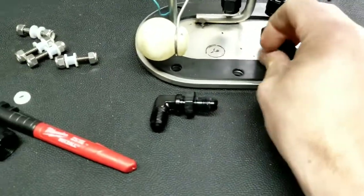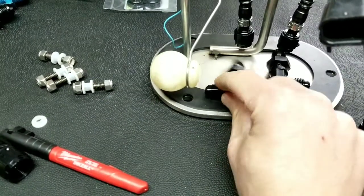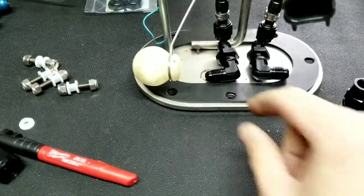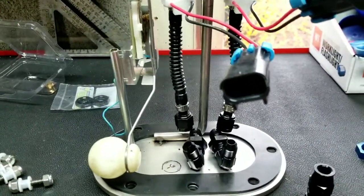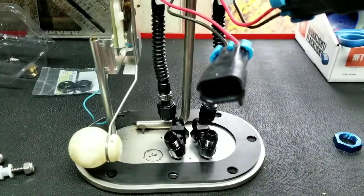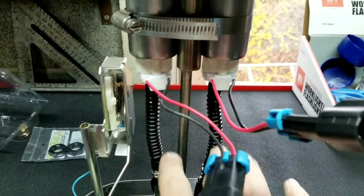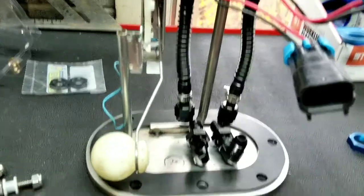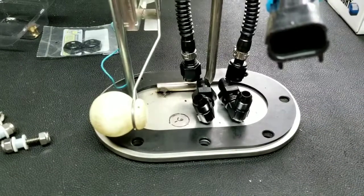So what I'm going to do is put a bulkhead on each pump. Obviously those will be coming out of the top hat. So I'll have a bulkhead on each line coming off the pump, and I'll join them outside of the tank, which will basically make these both straight as an arrow, so I won't have any super huge kinks in it, and I'll just join them outside the tank. So it's really just an extra hole I have to drill.